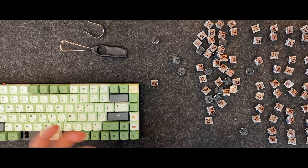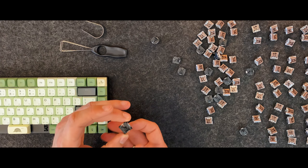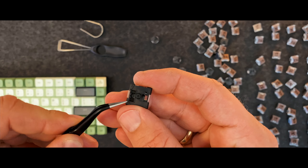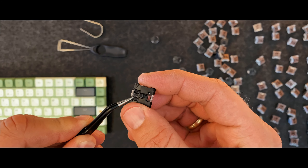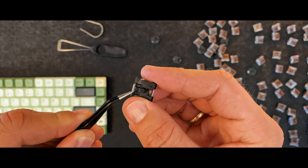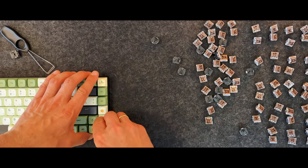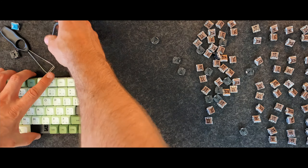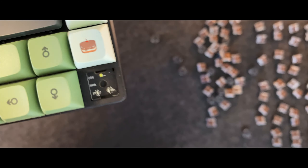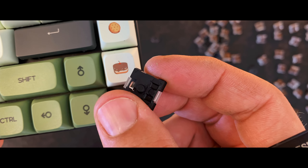So what is the issue with the brown switches? They're tactile and they have this nice clicky feel, but they're too sensitive. When you click the switch, you can see right here there's a little circle, and this plastic piece that pops up is actually breaking the connection between the light that goes from A to B on the keyboard. You can see there's light going from this point to that point, and whenever you press it down, you break the connection of the light — and when you do that, it registers as a click.